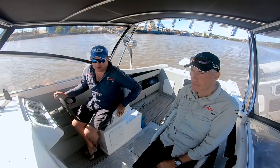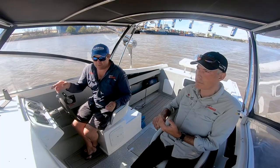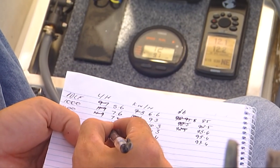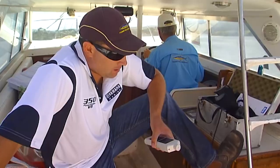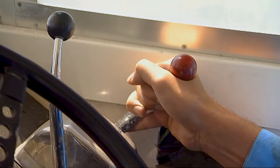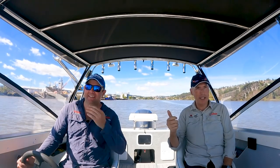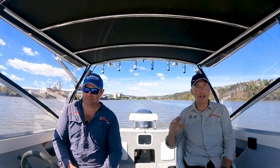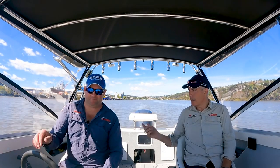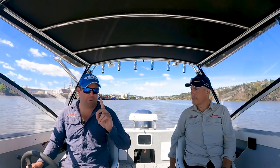It is now time to put the boat on the water and do sea trials. This was all about taking the numbers — we did measurements every 100 RPM: noise level, fuel burn, and speed. We also had a box that recorded acceleration. Some people did pick up in a previous video that we did some noise readings from the stern drive with the engine box open — I can promise you hand on heart that we did them properly from the start with the engine box closed. The numbers are good.